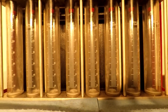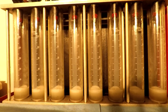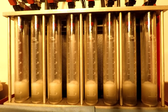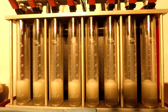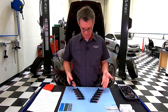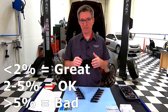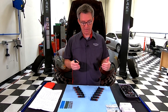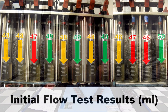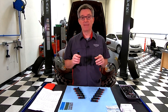Here you can see the pressure on, the spray pattern happening, and we're filling up the graduated cylinder from each of the injectors. When it's done, he shows the results. His goal for a set of injectors is that the flow rate should all be within 2% of each other at most. When he tested my injectors, the highest flow from one was 50 cc's, and the lowest was 46 cc's — that's a 4 cc difference, an 8% spread of variation. That's not very good at all.